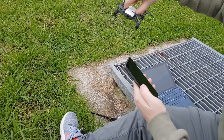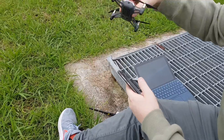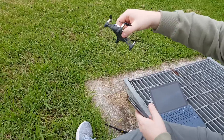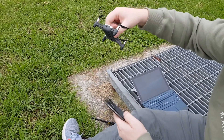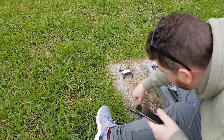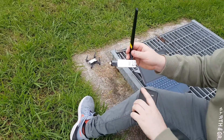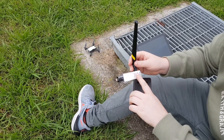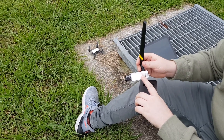You can only really go up about 15 meters and away from the phone about a hundred meters before you're out of range. There's a better way to communicate with your drone using your laptop. The first thing you need is a good wireless dongle. The one I'm using supports internet sharing — some won't work, so make sure yours does. You can use the onboard Wi-Fi, but the antenna on an external dongle is much better.